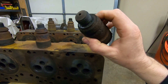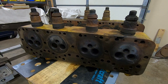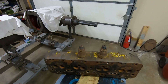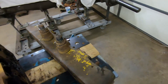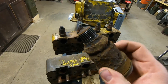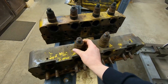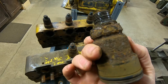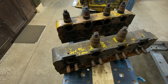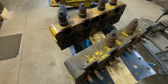That's kind of indicative of my experience with these pre-combustion chambers — either they come out without a fight, or it is hell to pay to get them out. We also put the wrench on the chambers on the other parts head, the one that had rust issues. We were two for four on that one. These came out without any heat, which surprised me, but you can see how badly rusted and corroded they are. These are right on the verge of being so rusty they have pinholes in them — I wouldn't trust these anyway. Two came out; one and four wanted to be really stuck, so we just left that alone. I'm pretty much writing what's left of that cylinder head off.